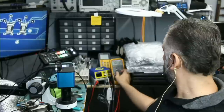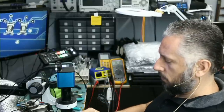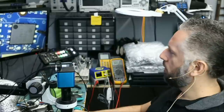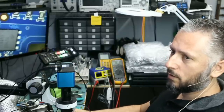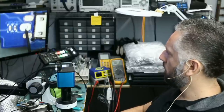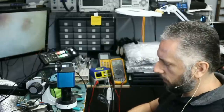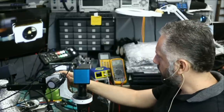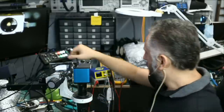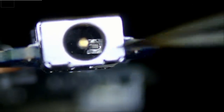Let me unplug the cable. What if we measure for a short on the connector itself, or on the drain of the first MOSFET? Look at that — we have a short here. We do not have a short at the second one, but we have a short at the first one, and that short is likely coming from the charging connector itself. Let's take a look at the connector from the inside. I think the ground may be touching the pin. That piece should be pointing upwards and not flat down — see how it's touching the pin? The short is coming from here.